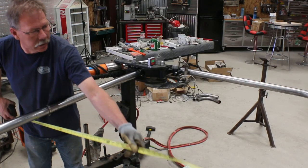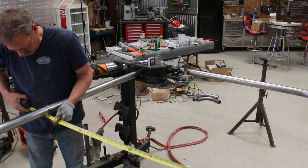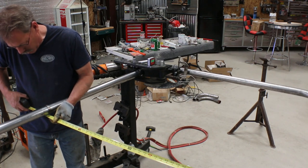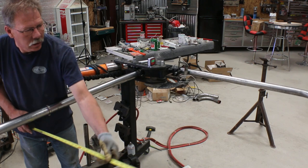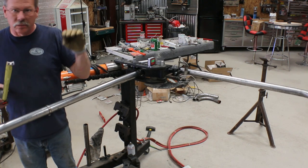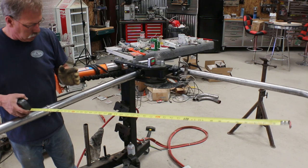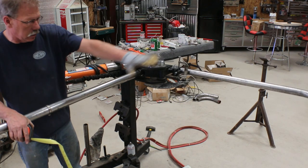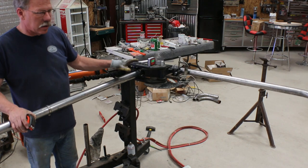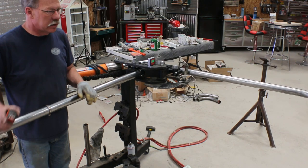We're going to pull a measurement from one leg to the other to make sure we're there, because we can always add another degree. 59 and an eighth was our max width - we're just a hair under that, so we'll want to pull it in just a little bit. We'll use a ratchet strap to squeeze it, just to get a nice even gap between it and the inside of the fender. So really we're done - we've got a nice bend, everything looks to be in the same plane. We can go ahead, take this out of the bender, cut the legs to the right angle, and get this tacked into the truck.